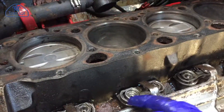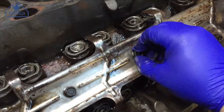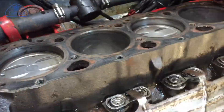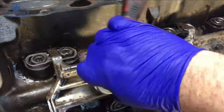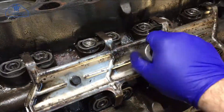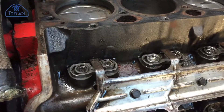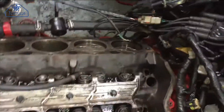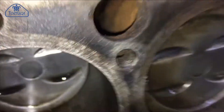The retaining spring was simply refitted with the three bolts being tightened up using a half-inch socket. By this point the engine had not turned for nearly three months. This resulted in the pistons becoming stuck to the cylinder walls. A good soaking with WD-40 for several days, followed by a few gentle taps with a hammer on each of the piston crowns, helped to overcome this.